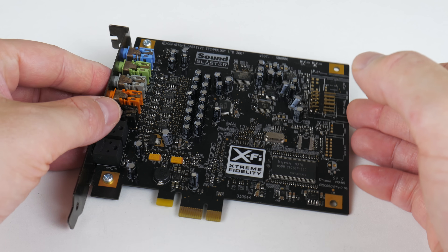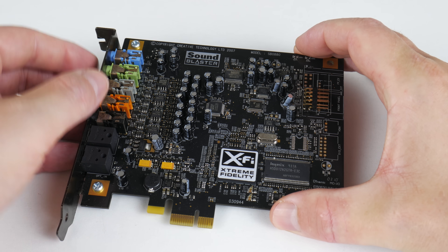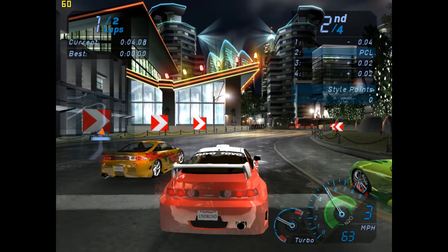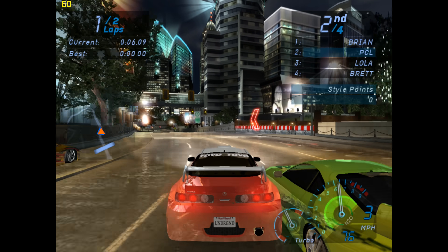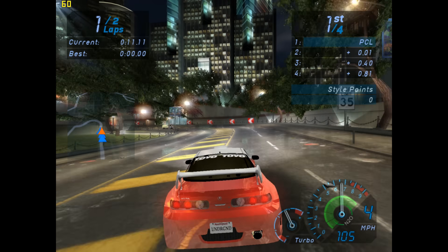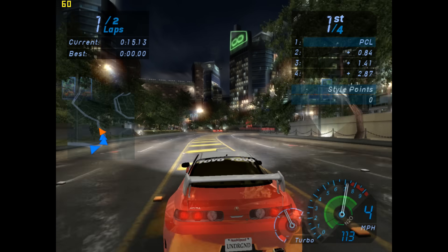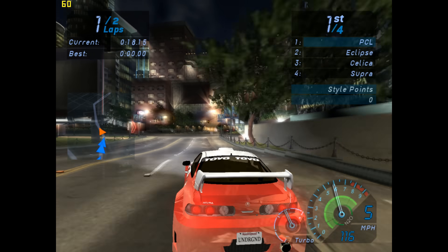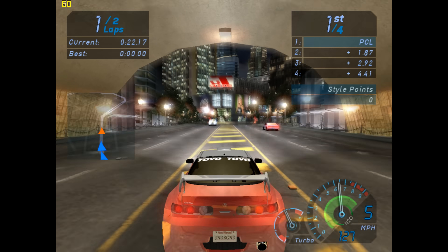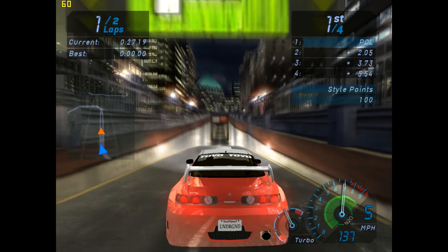A real highlight with Windows XP is good audio. I recommend using a card from Creative Labs — we're going with the X-Fi Titanium PCI Express, which supports EAX all versions up to version 5. Most Windows XP era games support this API and will sound better compared to running on a modern machine, because since Windows Vista, 3D hardware accelerated audio no longer works, so this is only available under Windows XP.